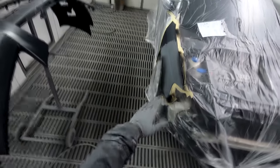Alright guys, my GoPro battery's actually just died on me, so I'm not sure exactly how far we got to in the talking about wet on wet stage here, but I did put a couple of little thin bits of wet on wet just over the cut throughs on this fender here. There was some bare metal here, and on the kind of colour that this is, I didn't even worry about putting any thinners over it. I also didn't load it up, so it should be totally fine.